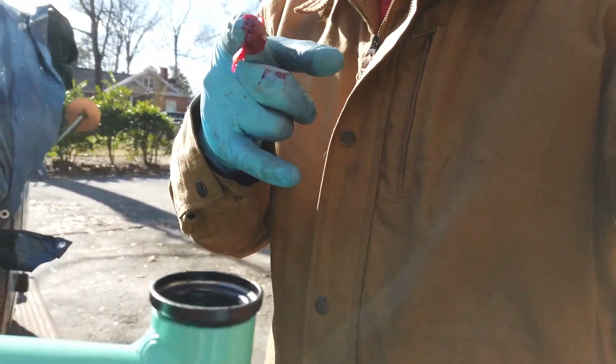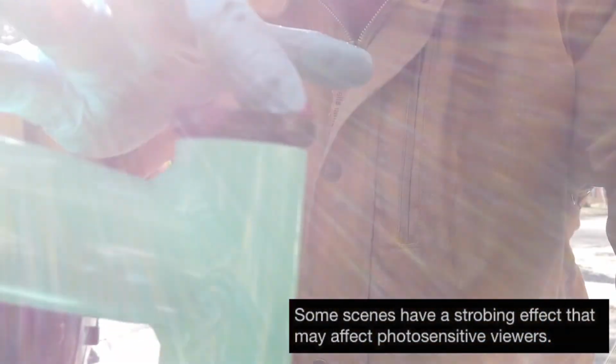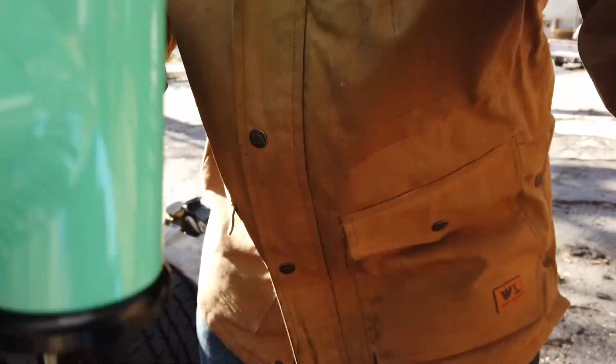Don't put away that grease yet, because when you install the cups on your frame, you're going to need to put grease inside the cups too, so that when you put your bearings in, besides the grease that you've put on them, there'll also be a good coating so it's not right against the metal. So grease those up real good, top and bottom.